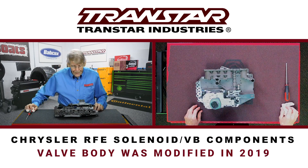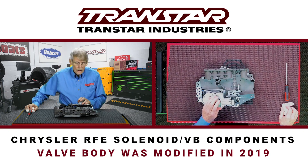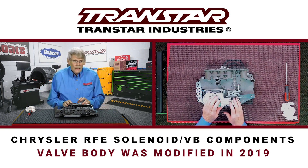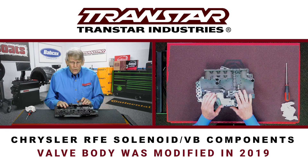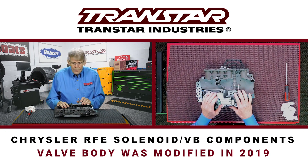What happened in 2019, when they came out with the blue connector and added an additional solenoid for lockup, they had to modify the valve body itself. So there is no way that you can utilize a 2018 back valve body for a 2019 up. There are, of course, many other components internally — piston housing, clutch drums, clutch quantities, one-way clutches and so on.